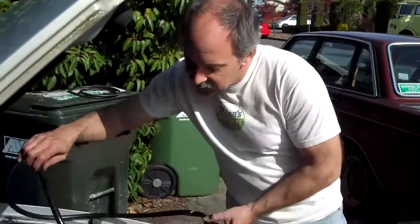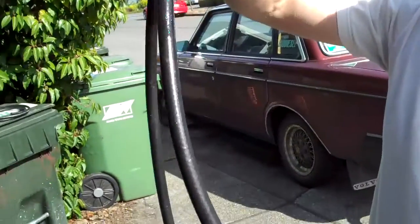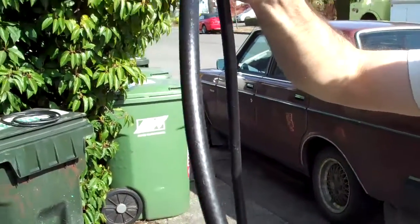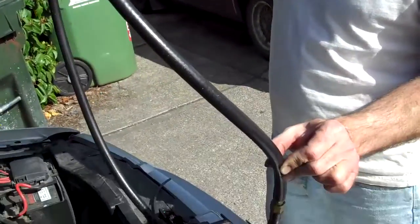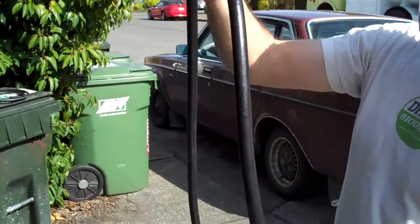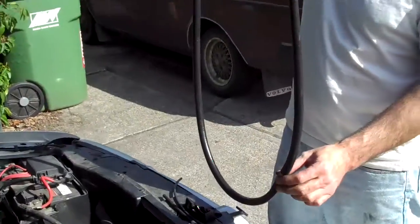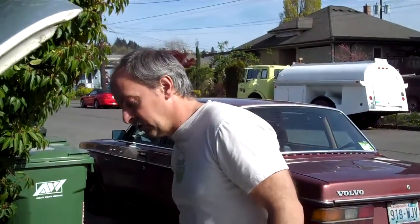It's expensive, but it works out quite well. If you have a questionable vehicle, like an older one, and the hoses begin to look like that — you can see it actually looks like it has fuel on the outside — it's not a biodiesel-compatible hose and it's on its way out. So you should open up the hood of your vehicle and look at things occasionally. Check the oil and the fluids and look at all that stuff.